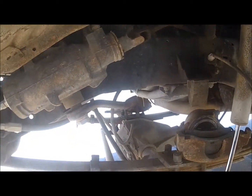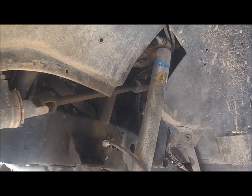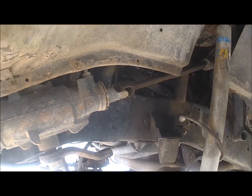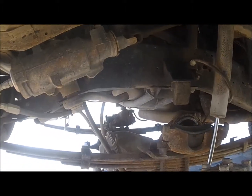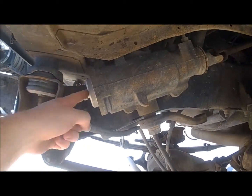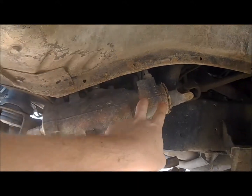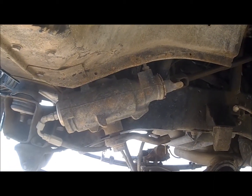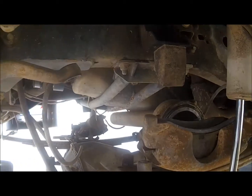It was from a Econoline van, and the end of it was reamed out to fit the Chevy tie rod because the Ford ones are a little bit too small. It's an XJ shaft — a Jeep shaft — that gets rid of the sloppy rubber boot joint up at the top and you get rid of the rag joint, going to universals instead. Great improvement for anybody looking to fix what they thought they were fixing by changing all their steering and still finding it sloppy — it might be that piece right there. You can see I'm tapped into the end of the box for my RAM and also into the top of the box.